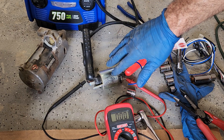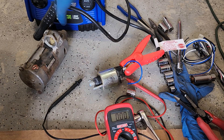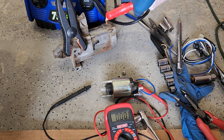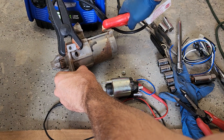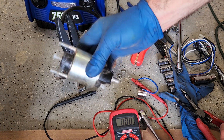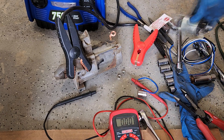So this is just a bench check — it's by no means the end-all be-all of whether this is the problem or not. This is just something to check if you think you're having trouble. For me, my problem is the starter motor — I get absolutely nothing and I should be getting something. The motor itself is a dead duck. Maybe this will help you figure out what's going on. Not that you can hardly buy a separate solenoid anymore, but if you're piecing things together with used parts like I do, it might help.